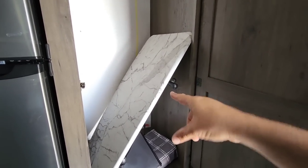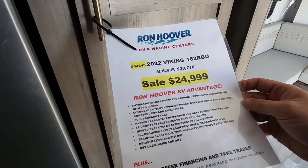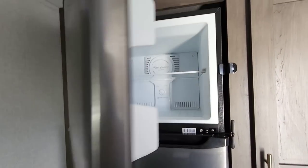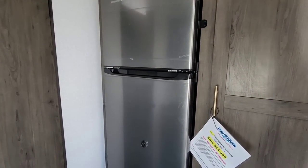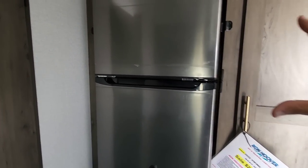This is the table for the dinette area. More storage down here. It has an MSRP of $33,716 and a sale price of $24,999. This is a 2022 Viking 162 RBU. It has an Everchill 12-volt refrigerator — a pretty good size — with a freezer up top. Before Everchill introduced the 12-volt refrigerator to the RV industry, this would likely have been a gas-electric unit. If you add a good solar setup and upgraded batteries, you can have extended time out without worrying about draining your batteries.